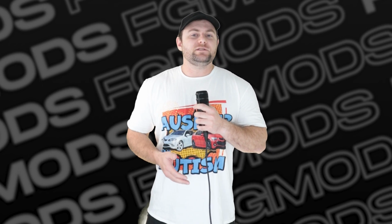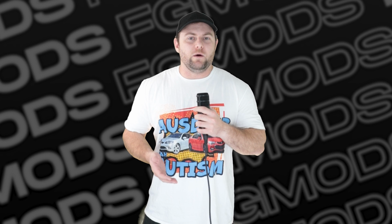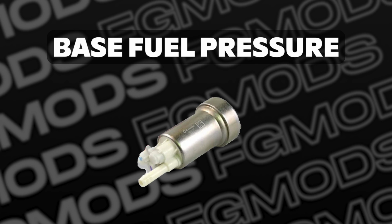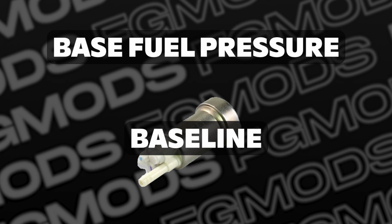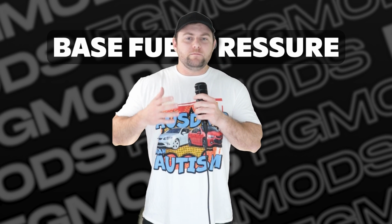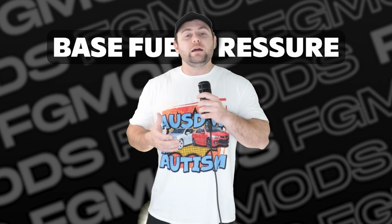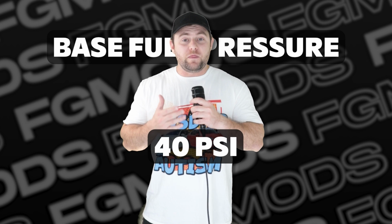Let's talk about some fuel system basics so we can understand what's going on. If you're not interested in learning, skip to this time code. First, we have base fuel pressure. This is the fuel pressure your system is aiming to achieve as its baseline. So we turn the car on, it's idling, and it should be sitting at base fuel pressure. In our system, let's call it 40 psi because that's what I'm using.